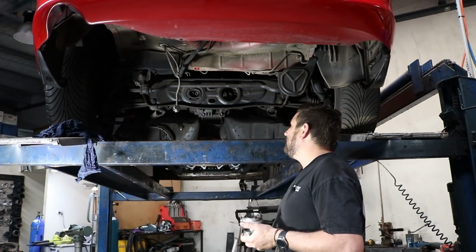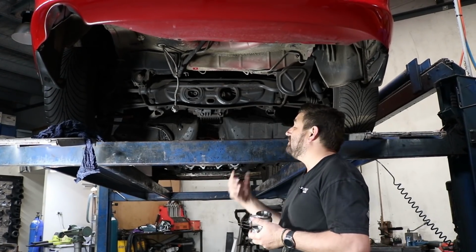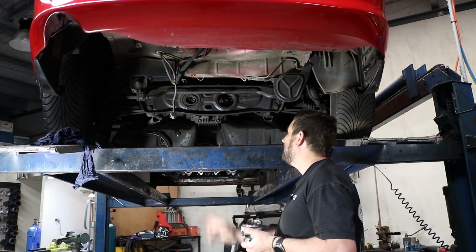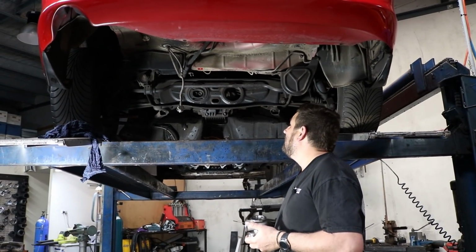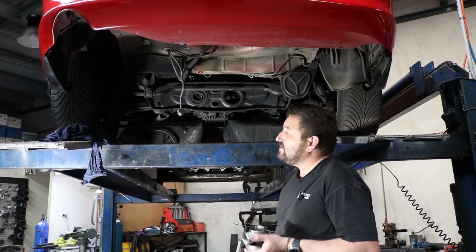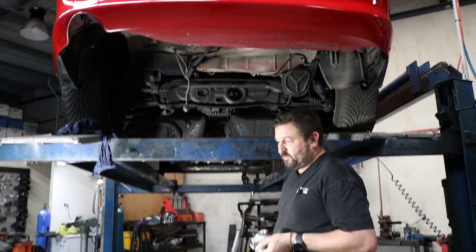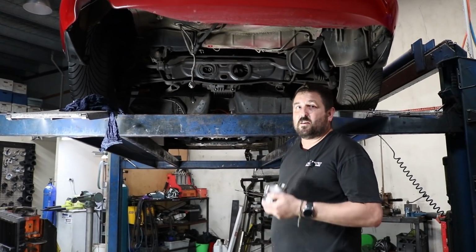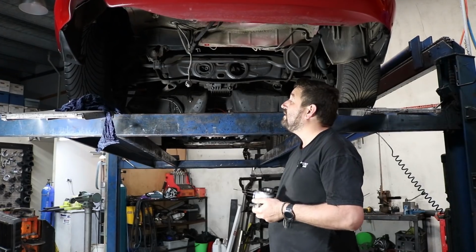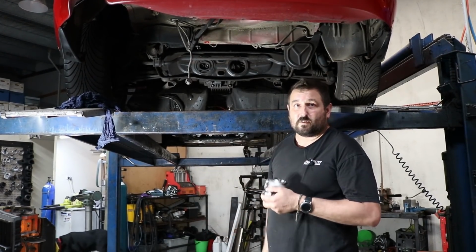The Torsen, you can weld them up, but it's bloody chunky and it's heavy. So if we go that route, we'll probably get a different open diff and then put a full spool or something in it. Yeah. It's probably a bit safer. It's weird. It'll power skid, and then if one wheel goes over a bump or something, it drives the wheel on the ground hard and you can't keep it in your lane. It's deadly. It's the only car I've ever had that's crossed the lane at the drags on the finish line.